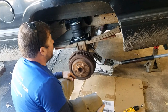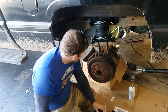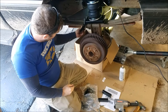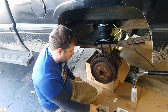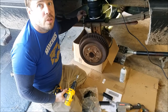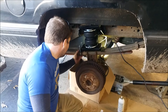Run the hoses — I'm gonna move those wires for the electrical system first. You want to get five to eight inches between the two brackets. I'm at seven and a half so I'm good. If you're not, you're gonna need spacers — they go under here. I need the long U-bolts. They have short ones if you only have a three-leaf spring system, but I can't use those. You've got a flat washer and locking nylon nuts.